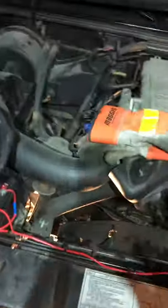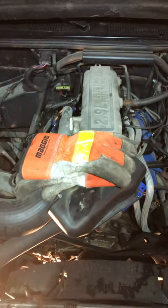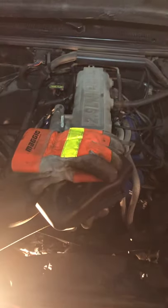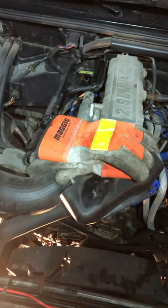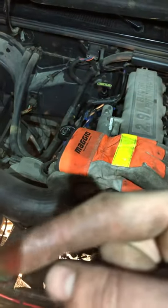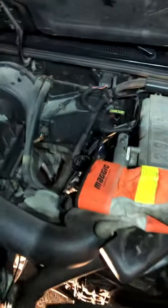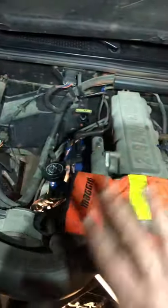After you do that, here's the trick I learned: start your truck and get it idling. Have it idle until it gets warmed up, as if you're about to take off. What that'll do is allow your transmission to get to operating temperature or close to it. Then you can check your fluid levels and fill as needed. On this truck, the only way to fill it is in the transmission dipstick tube, and it's very easy.